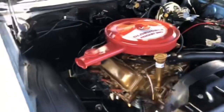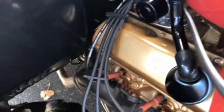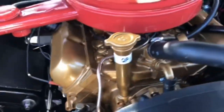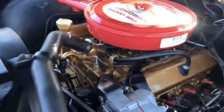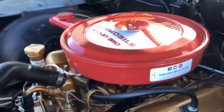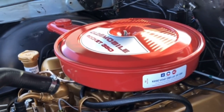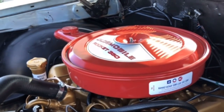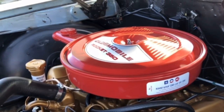The entire front clip was off right down to the frame rails. They were all detailed and painted, and the motor's been painted with lots of clear coat on that engine. It was originally a two-barrel; we converted it to a four-barrel. I rebuilt the Quadrajet — did it right, got the reaming kit and replaced the bushings in the base plate. The carburetor's all detailed. That's an original air cleaner I bought on eBay — sanded, primed, painted, clear-coated, of course.